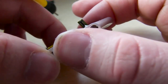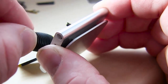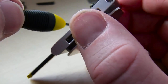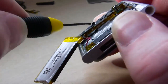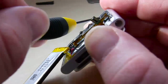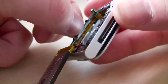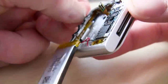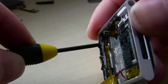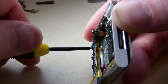So I'm looking and I'm thinking, okay, now I need to get to the power button. I need to make sure it works. And how does it push and tell it to turn on, turn off? So what I do is, once I get it apart, there's a tiny little shim inside between the power button and the bottom part of it. And I had to get some plastic. I used like this little plastic bead, and I just shaved off tiny little bits of plastic using a sharp knife or a razor blade. Then I either did that or I went to a piece of rubber. One or the other, I forgot what I grabbed. But it's not thick at all, and if it's too thick, it won't go back together right. And I used a bit of glue, just a pinhead of super glue, to put it on there and hold it.